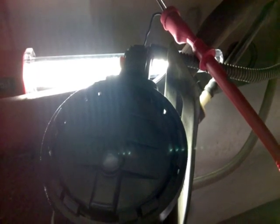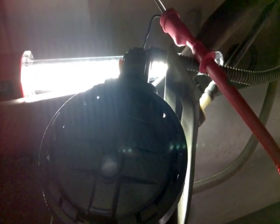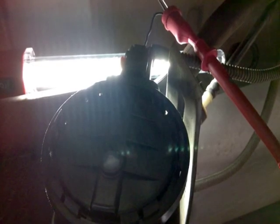And if you pump 1 inch of vacuum into the system, the switch should close, and the voltage should jump down to 0 volts. Which means that the switch has gone into a closed position and has sealed the system. So right now, I have my voltmeter set up. I'm going to take it to the engine bay and perform the 1 inch of vacuum into the system and make that 5 volts drop to 0 volts.